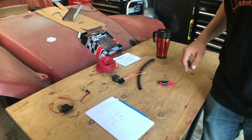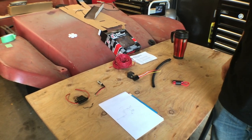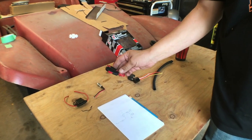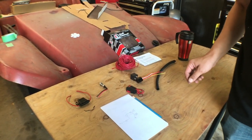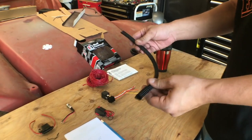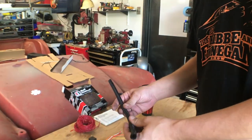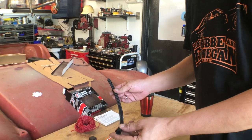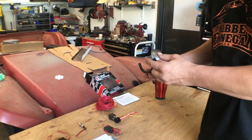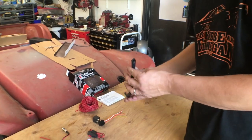But while the car is still up in the air, we want to take this opportunity to go ahead and get that shift button wired up, because we are going to run that wire under the car. And where it goes up into the floor, right around the shifting mechanism, I've got some of this flexible protective sleeve that we're going to run the wire through, and that'll prevent any kind of abrasion or anything that could cause a problem. So what we'll do is we'll get this wire run, put in place, and then we'll just show you some pictures here of what it looks like.